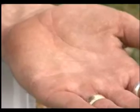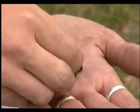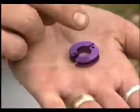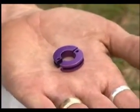There are 3-shoe clutches with composite shoes instead of aluminium for different bite characteristics. Early punch, late punch. Then you've got 2-shoe clutches, which are just a simple 2-shoe arrangement. Again, centrifugal force throws them out, and that's held back by a spring wrapped around the pair of them to hold them in.